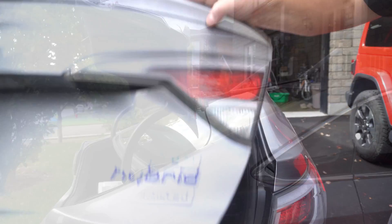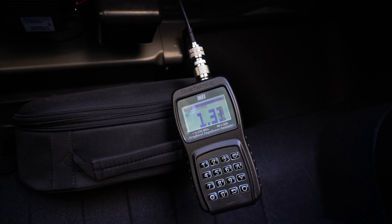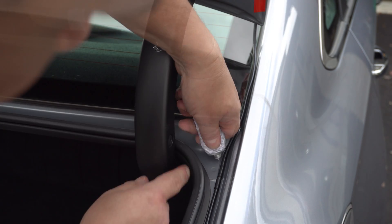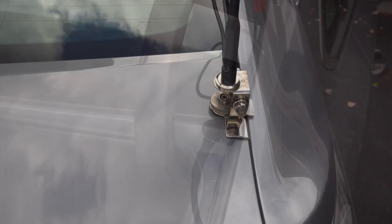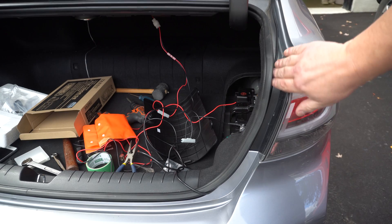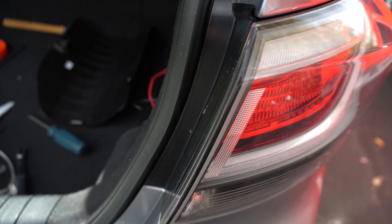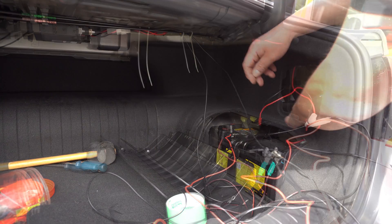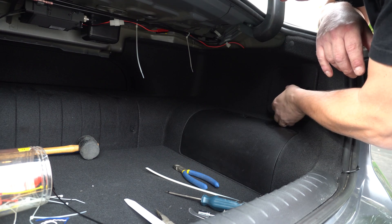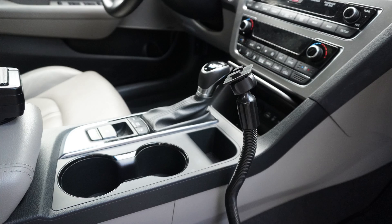The antenna is installed and it worked perfectly — it doesn't hit the car. The SWR is okay and could probably be improved by adding a ground wire to the bracket. Unfortunately I couldn't check the UHF SWR since my meter doesn't cover that range — I would need a different meter. I used some automotive goop to stick the coax cable down as it runs inside the groove. The next day it was very hard and everything held fine. I used a plastic trim tool to pass the wire under the trim — wires always go in at the bottom so no water can travel along them. I passed the power cable using an inline connector so I can unplug and replug as needed, then secured everything with zip ties.